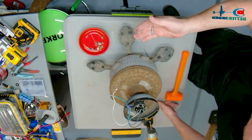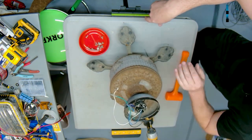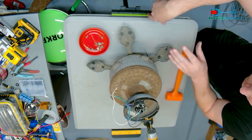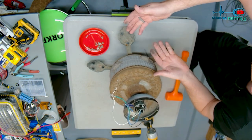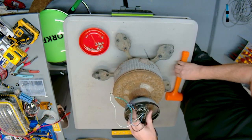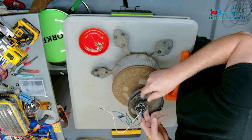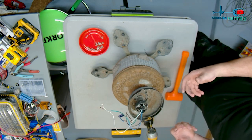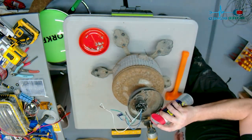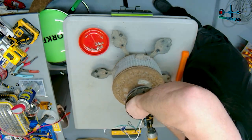Why would you want to know about this feature? Depending on the angle of your ceiling and how far the fan is from the people below, you might want to install a longer drop tube. To do that you have to knock out this pin - I would never know that had I not taken one of these apart. The corrosion is kind of holding it on, so I'm going to get a little lube and spray it in there.